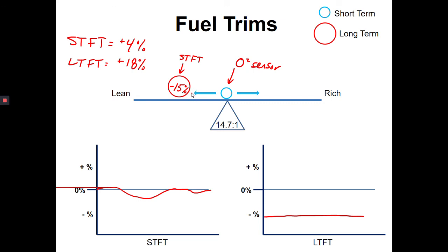I really hope this video helped explain a little bit about fuel trims, what they're doing, and the purpose of them. If you've got a vehicle and you're looking at your fuel trims, focus on your long-term for diagnosis of large issues such as vacuum leaks, which would cause a positive percentage — because positive is adding fuel — or things like inadvertent fuel being added, which would be a negative. You could also use your fuel trim data for diagnosing bad oxygen sensors or wideband sensors.